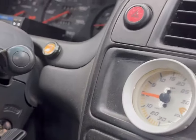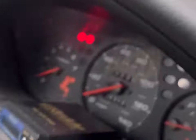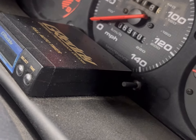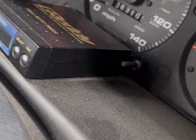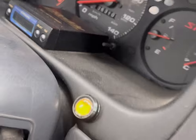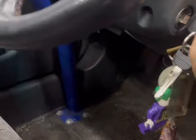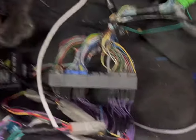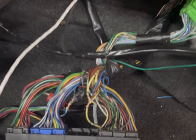What you want to do is disconnect your speed sensor from your transmission — whether it be a K-series or B-series. This is obviously a B-series EK, 1996. I set it all up on his OBD2 side. And then if you spin the wheel, you'll see the miles per hour come up — you know you did your job. If you guys have any questions or concerns, let us know. Hopefully this video helped shed some light on the speed sensor installation. Thank you guys for watching.